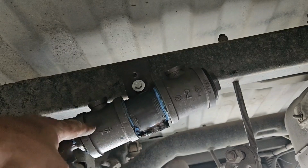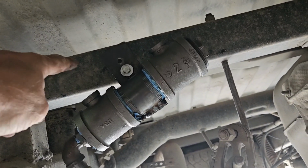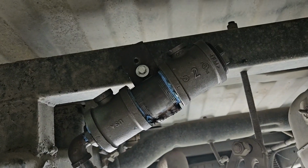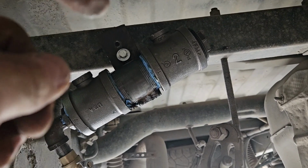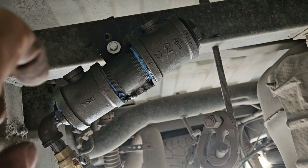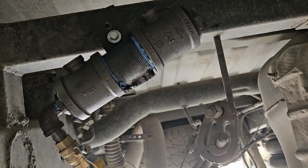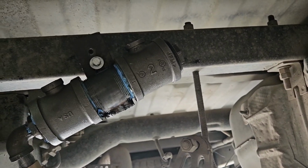You know, obviously not tight and I don't have the top hole in yet. So I'm going to get some fittings on. Then I am putting two valves there and there. One to fill, the other to let air out. And then the other thing is after this is purged and I get all the air out of it and it's running, I'll take the air compressor to one and charge it with a little bit of air, close it off, and this, as a little pressure vessel, will keep pressure in the system, so as the pipes get hot, that will cause the water to just naturally travel, hopefully. And this being the highest point, that should get all the air out just like a little mini boiler system.